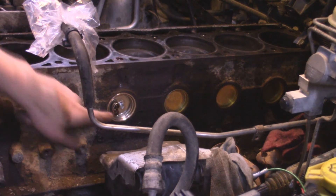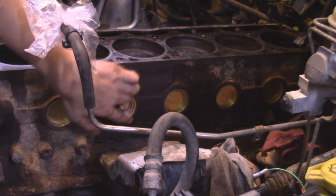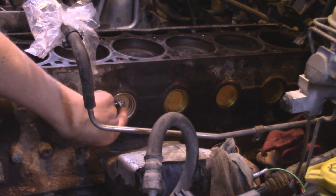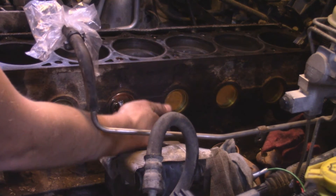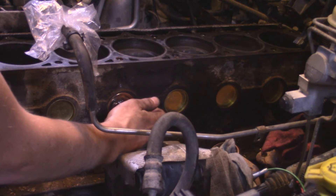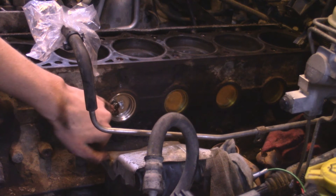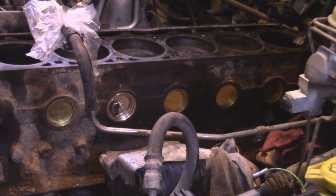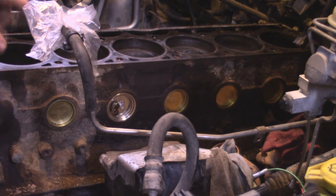When putting a block heater in, it basically fits right into place — you can push it in by hand. It has a little o-ring on the inside and you want to put a little bit of water or antifreeze to help lube that up, then push it into place. When it's all the way in, you can tighten up the center screw because it has an anchor on the back side that will keep it from coming out. When you put it in, make sure you don't use the anchor to draw in the whole plug because it will tear up the little o-ring used for the center screw — push it in first and then tighten it up. I chose to put my block heater on the second hole because if I put a normal freeze plug there, I would have a hard time hammering it in straight because of the engine mount being in the way.